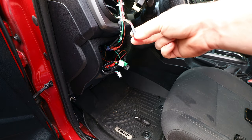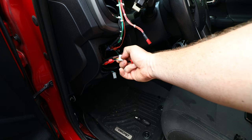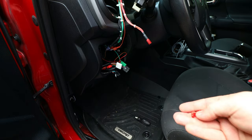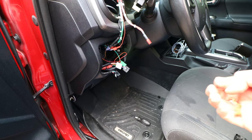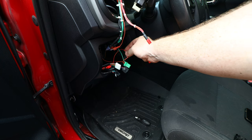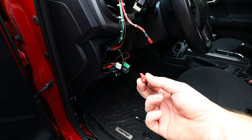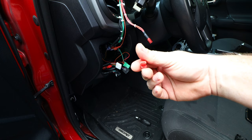To do this, we will take our red two wires that I've all connected together and tap into the power wire for the illumination circuit, which is the green wire for the rear window switch. Most of these wires — if you don't have a power rear window — the green wire on each one of these tends to be the illumination circuit for that particular switch. Since I've already tapped into the original wiring harness once, I don't want to tap into it again. So I'm going to tap into this previously installed OEM style switch by using a vampire clip on the red two wire right here. All this clip does is bite down onto the wire, you snap it closed, and then you connect the male connector into the butt of the vampire clip.